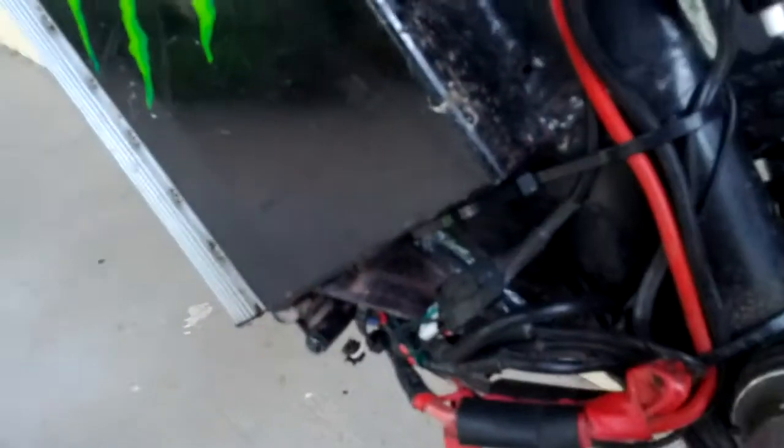So that runs back to this plug pack that I've wired in, from the old crappy lamp switch. The plug pack puts out 12 volts. I think it was a variable one, but I switched it to 12. And so I've just got 100 volts or whatever pack voltage straight into the 240 volt pins on that, and that gives out 12 volts.